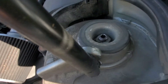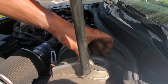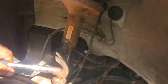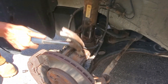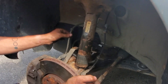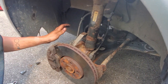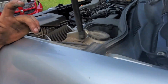It should pop out. Then you loosen the top nut — just gun it off. This piece is what holds it to the engine bay, and this is part of the strut assembly. The whole piece should fall out. Make sure wires are out of the way — you don't want to break your flex line or brake line. With your axle, lower control arm, and sway bar attached, it's not going to go too far. Get it from the top and the piece comes out.